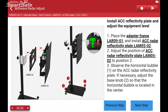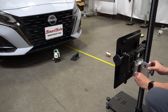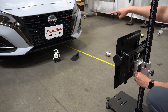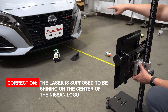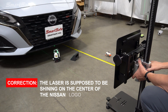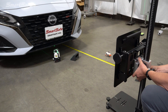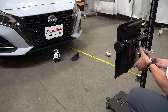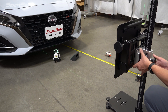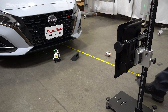The last step is to go ahead and set the height and angle of the target. First we'll go ahead and move this to position two. Next we'll turn on the point laser which you can see radiating on our sign, and we'll need to bring the target up to the center point of the radar. For this particular Nissan it's behind the front plate, so we'll go ahead and adjust that height. We'll bring it up and you can see the laser right between the two S's, and then we'll lock it down and confirm that we're still centered.